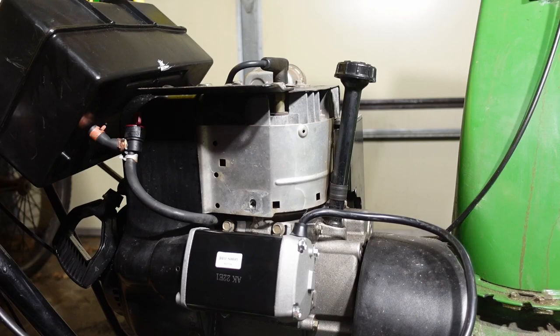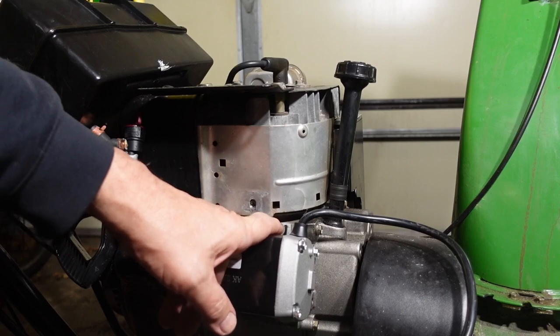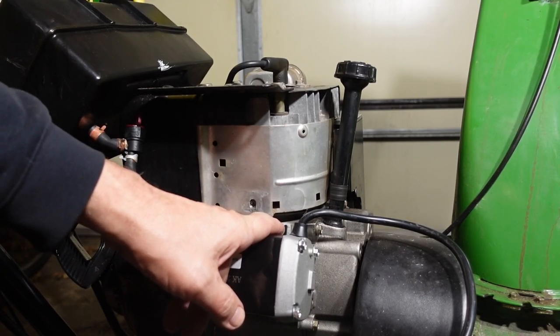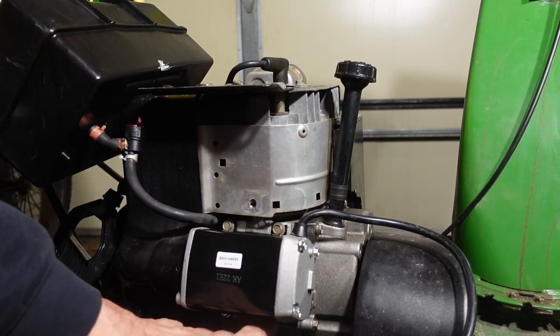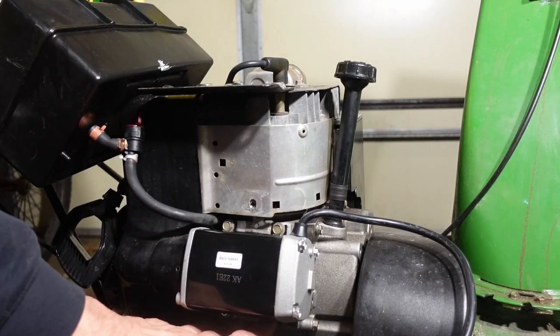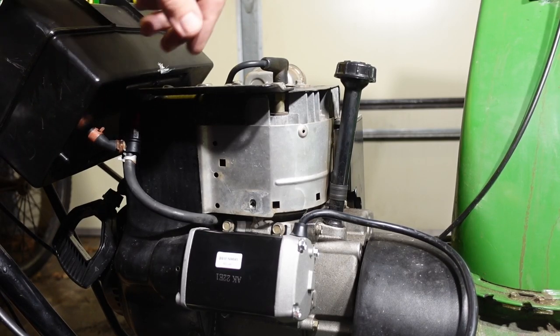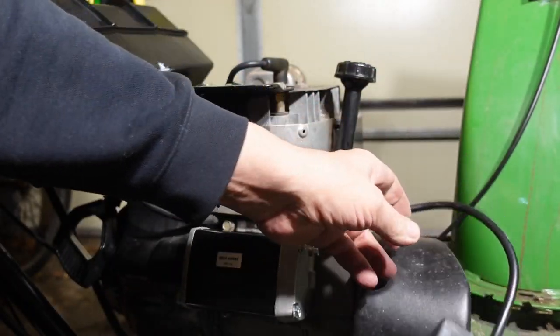So, two things, I think. One is that these pins, or these bolts, aren't really hold-down pins. They're centering pins to keep it in place. So I wanted to get these in place first to make sure that it was in the right section, then get these into the engine block. And now it seems to be working fine. I'm okay with that. I call it a win, reattach the tank, and then mount the starter up on the top.